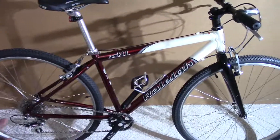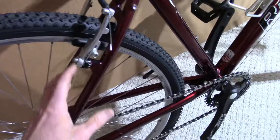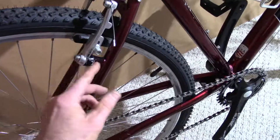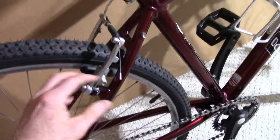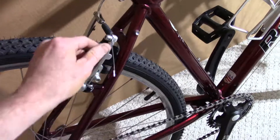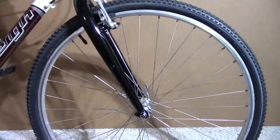First off are maintenance items. I took off the forks and the wheels, went through all the bearings, cleared out the old grease, inspected and packed with new grease, and adjusted the brakes. My rim brakes have a post on the frame and on the front fork, and the grease in there gums up over time. I took the brakes off, cleaned everything up, re-lubricated, and adjusted everything. Now the brakes work really well — one side used to always drag no matter how I adjusted it, but after the service they're working great.